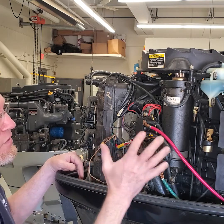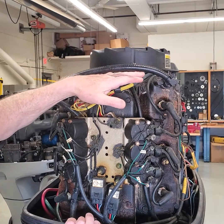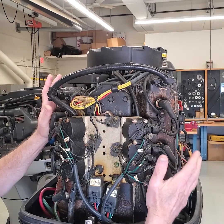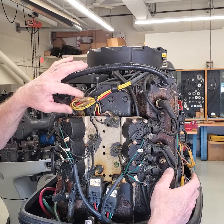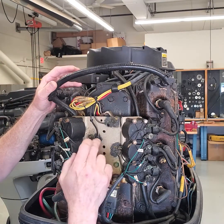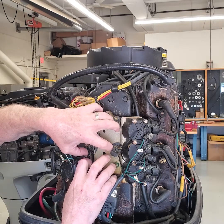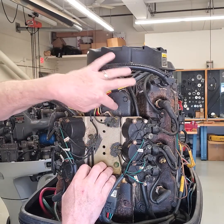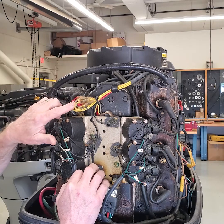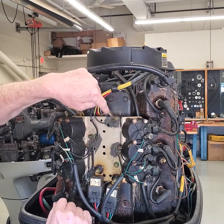What really set this engine apart was the charging system — it comes off the top, and underneath the stator are the charging wires. All of these yellow wires are AC output voltage coming out of the stator. What set this engine apart was they got away from a single charging output stator and went to two sets of stator windings for the charging systems. They have two voltage regulators behind this panel, which has your three coils for one bank and three coils for the other.